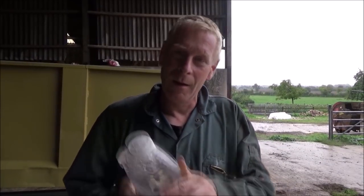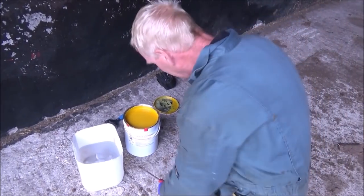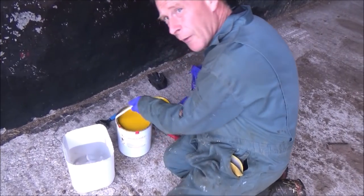Okay, so we're on take two of this trailer now. I stopped yesterday because of the thickness of the paint. I've been down to Screwfix and got myself two litres of white spirit, which is also paint thinner as well as brush cleaner. Going to mix some of that in because the problem is if I put too much it'll be too thin. I'll try to get some on the trailer. Ideally it'd be better with a spray gun but I haven't got one, so doing it with a brush - don't want it too thick otherwise it'll run. I'll have to decant some of this.